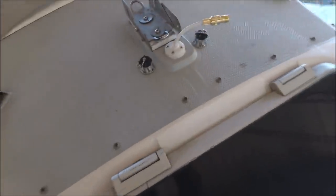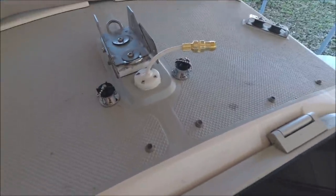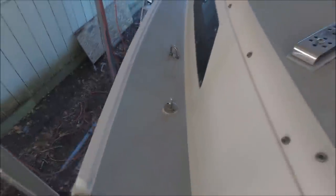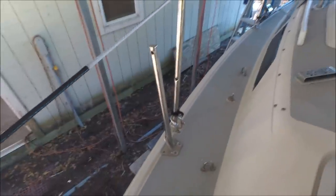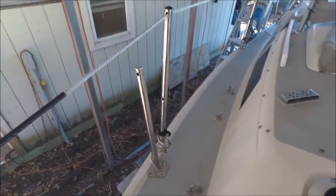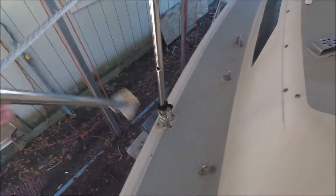We've added a couple of wiring connectors for the mast wires and VHF cable. We replaced a broken lower shroud chain plate with bow-eye type U-bolts, except for the center one which is the upper shroud and still looks in good shape. We also replaced the original low 18-inch lifeline stanchions with standard 24-inch, because the shorter ones can throw you overboard since they come up below the knee. The Dyneema lifeline was already there — we just adjusted it.